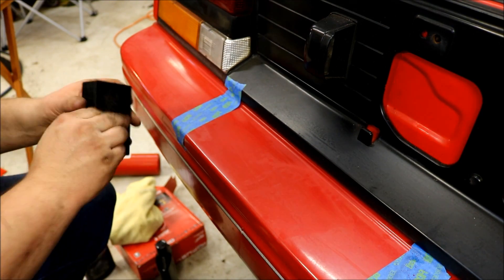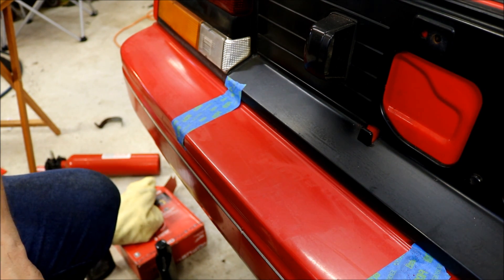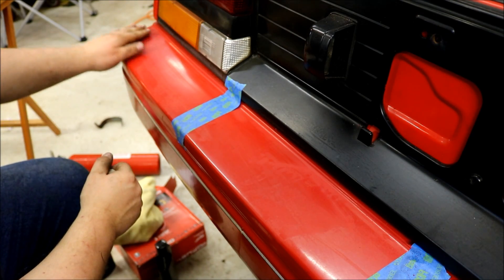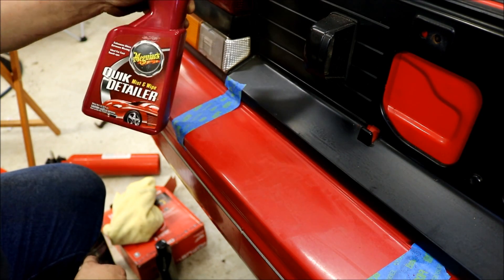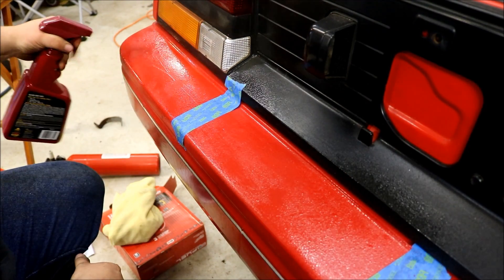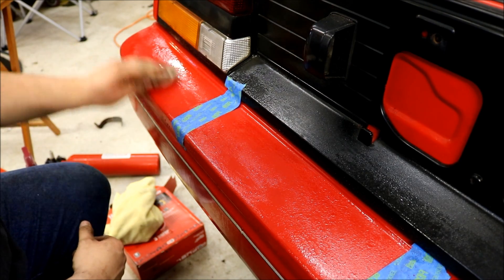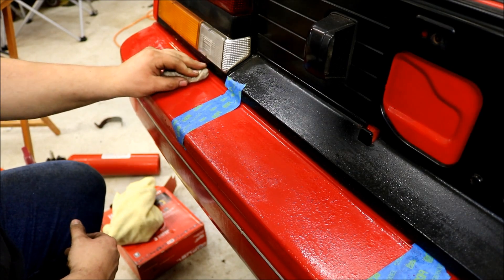Now if you don't know what clay bar is, it is clay — I have two of them in here. It sticks. The clay bar glides across the coat when you put a little bit of lubricant on it, and we're using Meguiar's Quick Detailer mist and wipe. Basically what we're doing is spray across — we're just doing the tops here just to show you in this video. What we're going to do is just guide the clay bar along, and what you're doing is not scratching it.